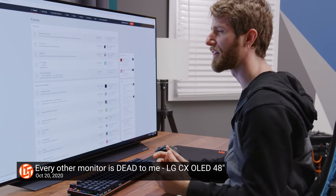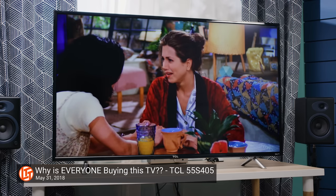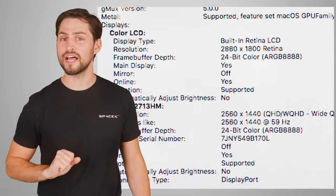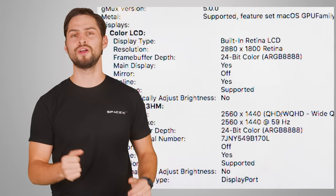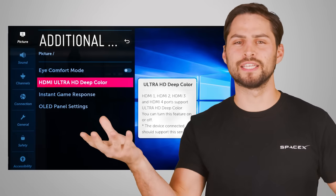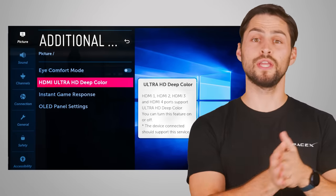Chroma subsampling is fine for content with smooth gradations like movies, sporting events, and even many video games. But if the display you have hooked up to your PC is subsampling, text and other UI elements with sharp edges can look smudged and blurry. This typically is not an issue for actual computer monitors, as these are usually designed to display a 4:4:4 signal, but televisions are notorious for undesirable subsampling — which you may have seen if you've ever tried to type a Word document or read an article in your browser on your living room TV, an artifact sometimes called fringing. Nowadays, many modern TVs can be specifically told that they're connected to a PC and therefore should not subsample. If you can locate a setting called something like UHD color, deep color, RGB, or something similar, switching to it should force the TV to display your images in 4:4:4. And other times, simply selecting a PC or computer mode on your TV will also do the trick.